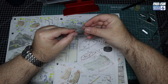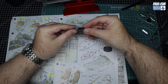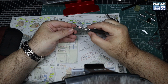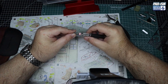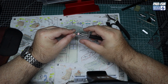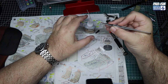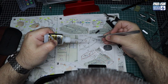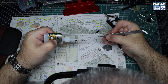There we go. And we're going to test our handbrake lever and see how it goes. So there's two little holes in either side with that slot, and then there's a raised dog leg which holds a spring. Now the spring also attaches here, so I'm drilling through the handbrake lever, and we have a flat rivet to place in there that hangs over the edge, which the spring attaches to. Now that sounds nice and easy, but in the 7 weeks of filming this, I've gone and lost the spring.